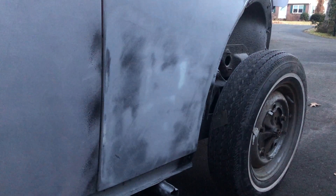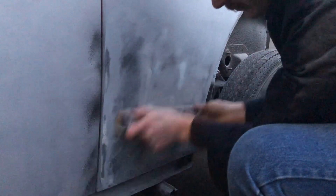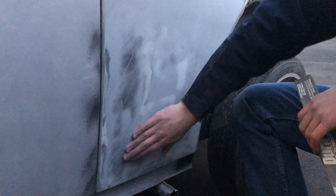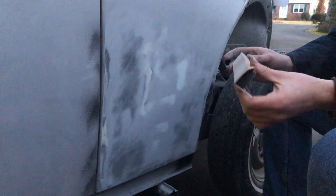It's a little dark, but it's easier to move around. You can see this is that icing, and you can see these are all high spots which are now leveling out. This is an insane low spot which I don't recall, but it's obviously there. Having a block this big is really useful. When you're using the shorter blocks, you're going to miss stuff like this — when you go with a longer block, it levels it all out.